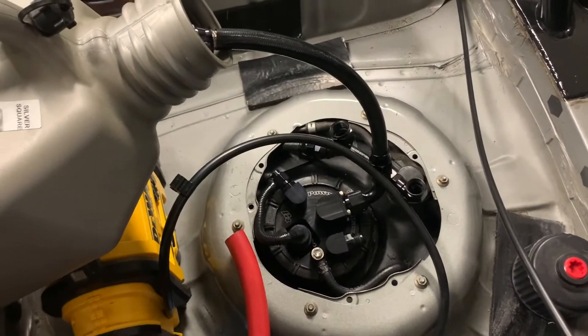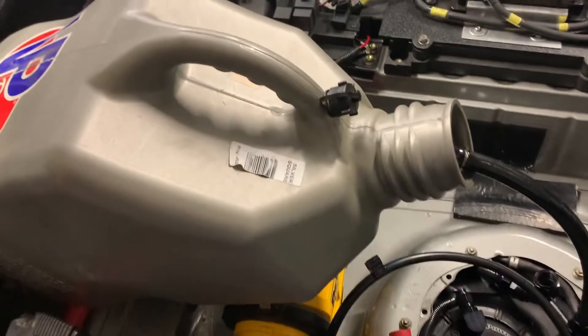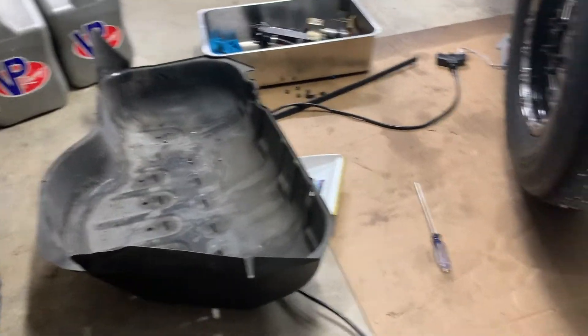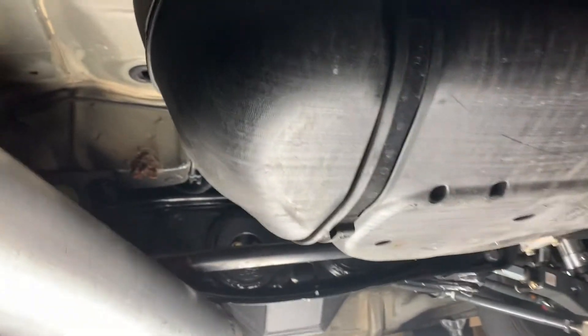So just draining the fuel out right now, then removing the hanger, removing the OEM fuel tank. We got the protective cover off the fuel tank, got the fuel hanger out. This is still a Powerhouse mechanical hanger that they have discontinued now, with a primer pump attached. Now I just got to get the tank out. Looks like it's got some straps over here and then the fuel neck. I haven't taken one of these out before, but we'll figure it out.